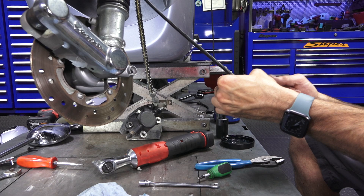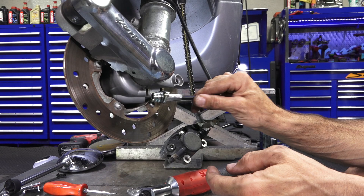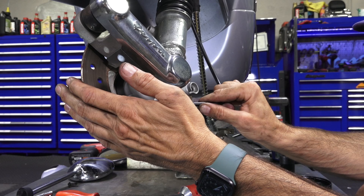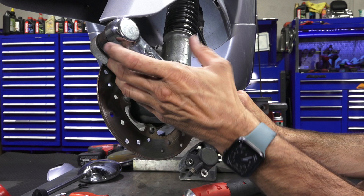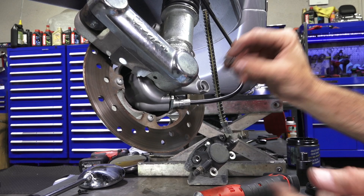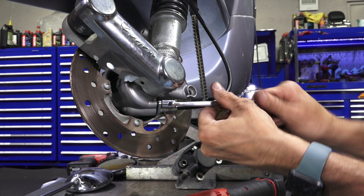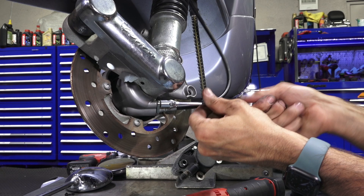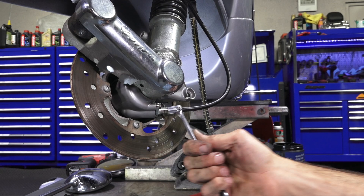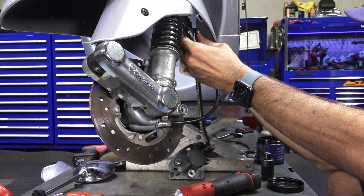Put a small amount of grease on those O-rings and the gear in there, then go ahead and engage the cable — see how it just went right into the plastic speedometer gear, no big deal. Pretty much just push it right in, which is a lot easier than dealing with those three other components used on the older style. Then take the 8mm combo wrench — don't need to go all that tight, small 5mm fastener — and voilà. You can see the cable's in the right spot, the little bracket is going to go right back in the same spot, and the caliper will go right there.